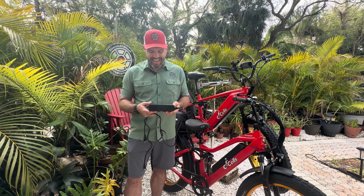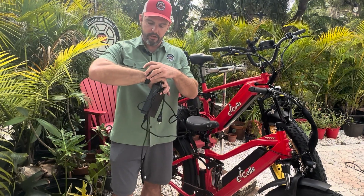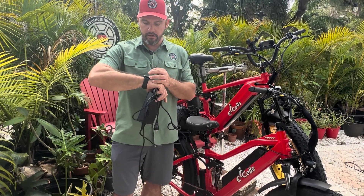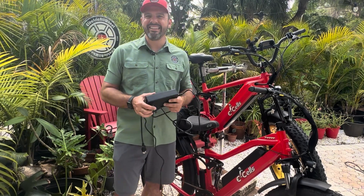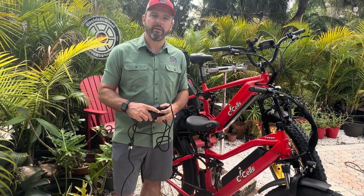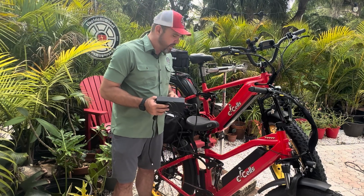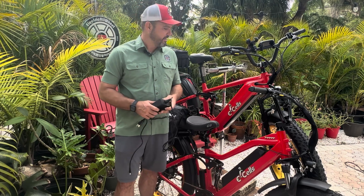This is made by Megatech. This is a three amp charger. So let's do some math: 35 amp hours on the Kingstar divided by three is 11 hours — so an overnight and then some, about eight hours of sleep. So put it in early before you go to bed and by the time you get back to it the next day, it's going to be charged up. If you only have one charger, I haven't picked up the second battery — I'm sure it has a charge port for it. You know what we do here at Electric All Wheels, so definitely wanted to get an idea of what's going on inside.